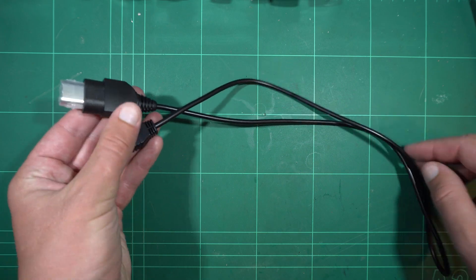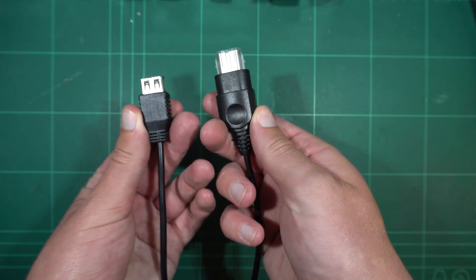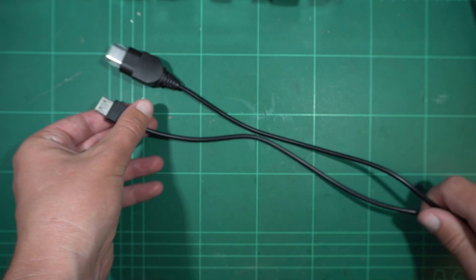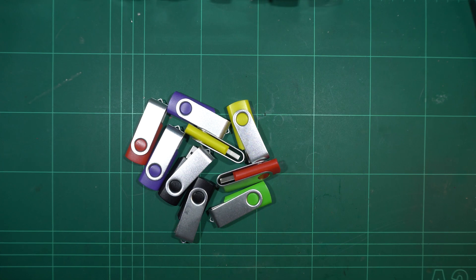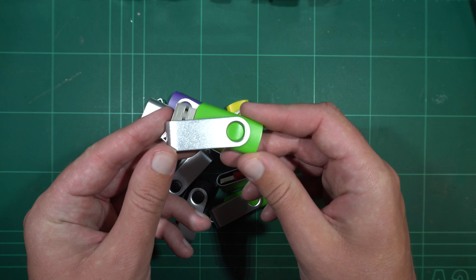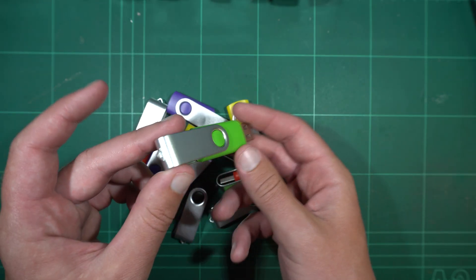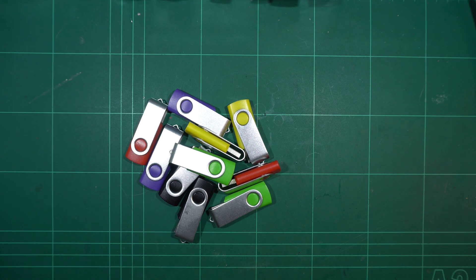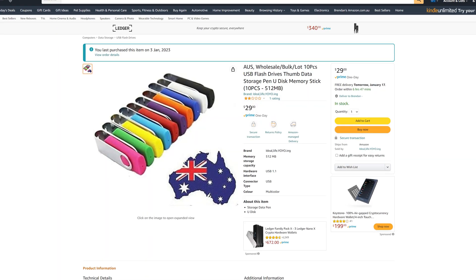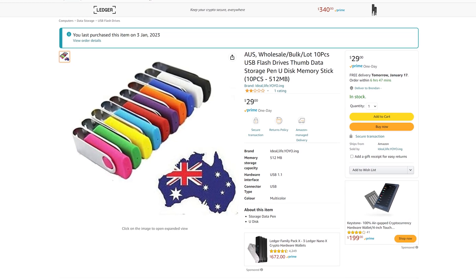There are a few items you'll need for this soft mod. First, you'll need a cable. This plugs into an Xbox controller port but includes a female USB port on the other end. These cost approximately $10 on sites like eBay or Amazon. Most modern USB flash drives will not be compatible with the Xbox — it needs to be USB 1.1 compatible and under 1GB in capacity. You may have a suitable drive in a drawer, but I had to buy one online. Not expensive or difficult to find, but you're unlikely to find one in retail.